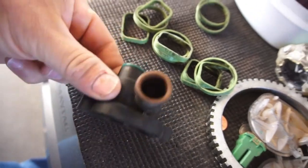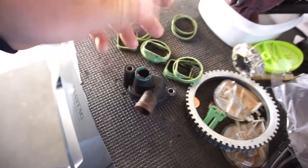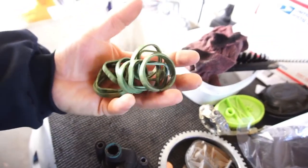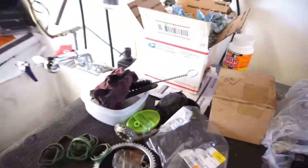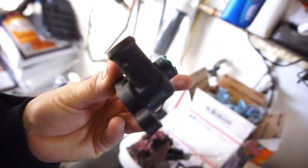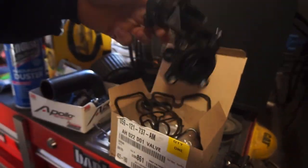Here's the piece that I broke — I broke this top piece here. When you buy this part it comes with the o-ring on the bottom, but it doesn't come with the o-ring on the top, so you have to buy the o-ring separately. I bought all these even though you don't necessarily need them — you can put the intake manifold on and off — but I just felt more comfortable replacing them. I'm pretty sure this particular piece wasn't leaking; I didn't see any signs of it leaking anywhere.